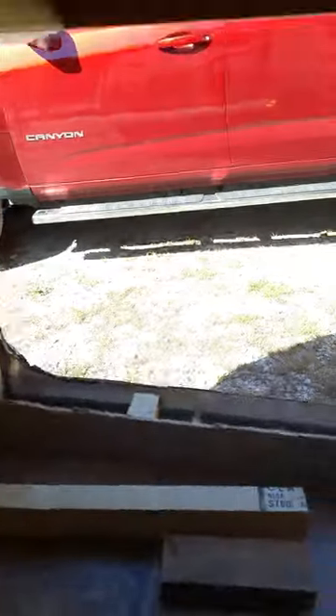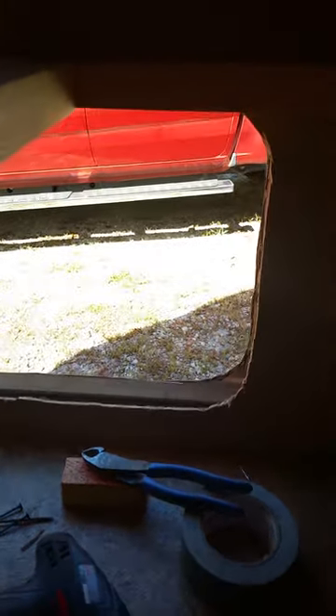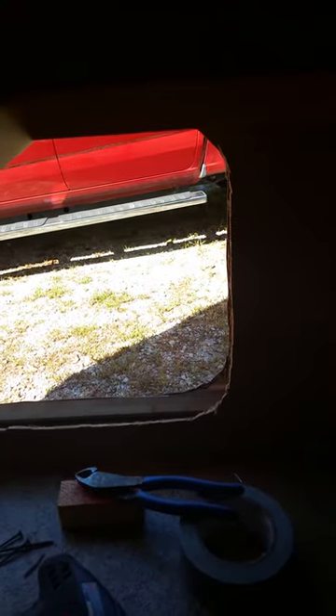This was probably the most important part. I met a guy at an RV show and he said to start from the inside. What I did with my cargo door is I laid it down and made a template. As you can see, when I put the template in, I had it over too far to one side. The good thing about doing it on the inside is that if you make a mistake like I did, you just move the template over, recut the inside first, and then go to the outside and cut it. So that's a huge deal — take your time. It's not super hard but it is a little intimidating.